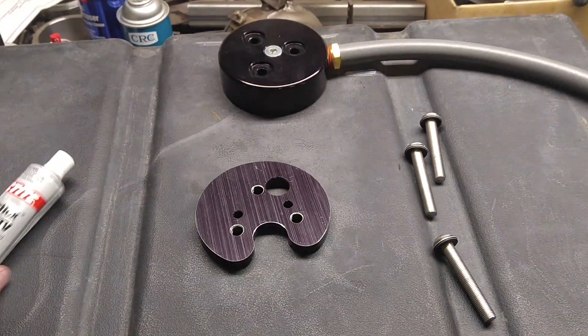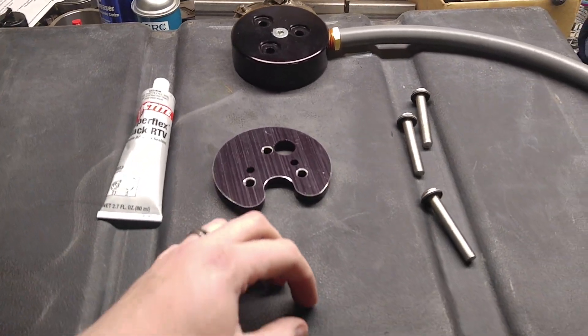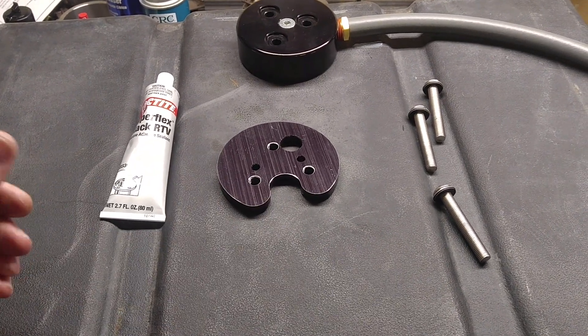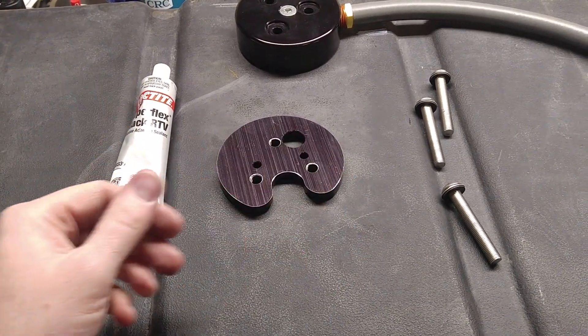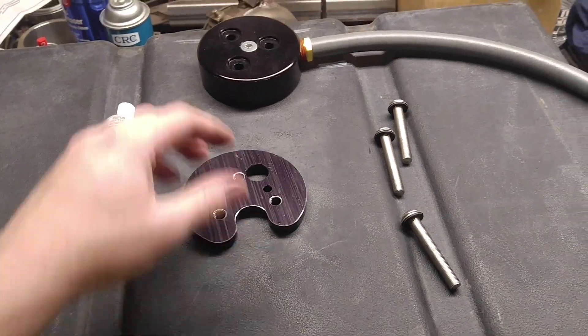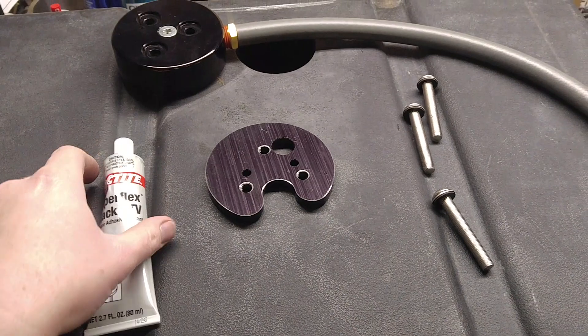Back — it's actually been a few weeks. We went to go wash out the tank and there was some like film in the bottom of it, I think from old gas that was left in it, leaving some ethanol or something behind. So we took a pressure washer to it, scrubbed out the inside with a little soap and water, and it's good to go now.